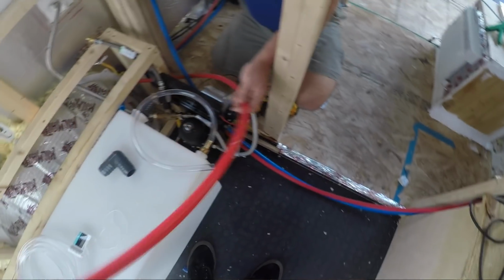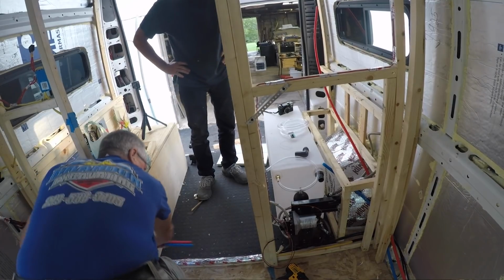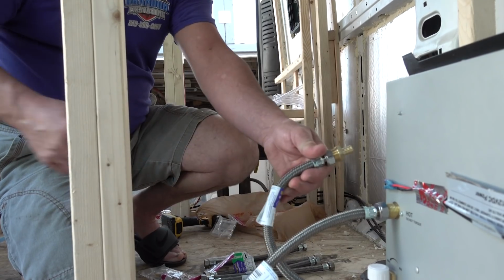He told us this is what's going to happen in order to get your water running to your shower, to your water heater, back to your sink, and then out. And he introduced us to this PEX pipe. It is a really great product. It's not the cheapest thing in the world, but you can really bend it around corners and it's super forgiving. And when it's cold, the water has a place to expand if it freezes. Copper doesn't allow that. No. And he also brought threaded braided lines. Everything we were working with was 1/2-inch.